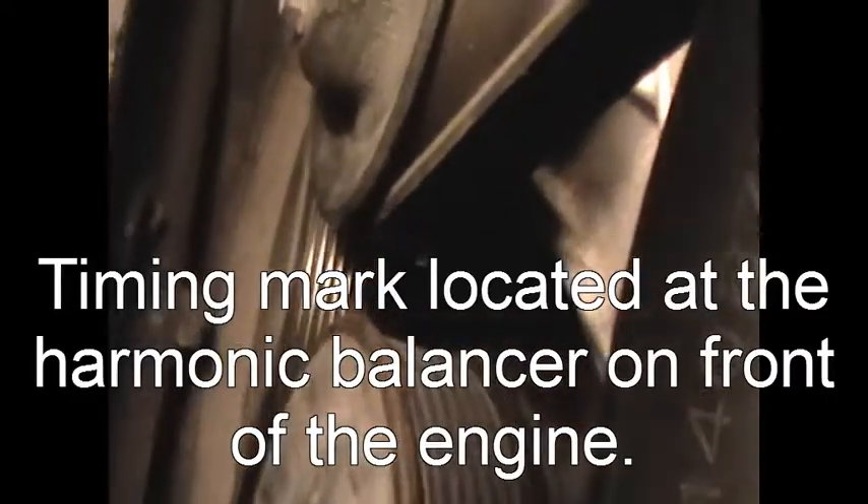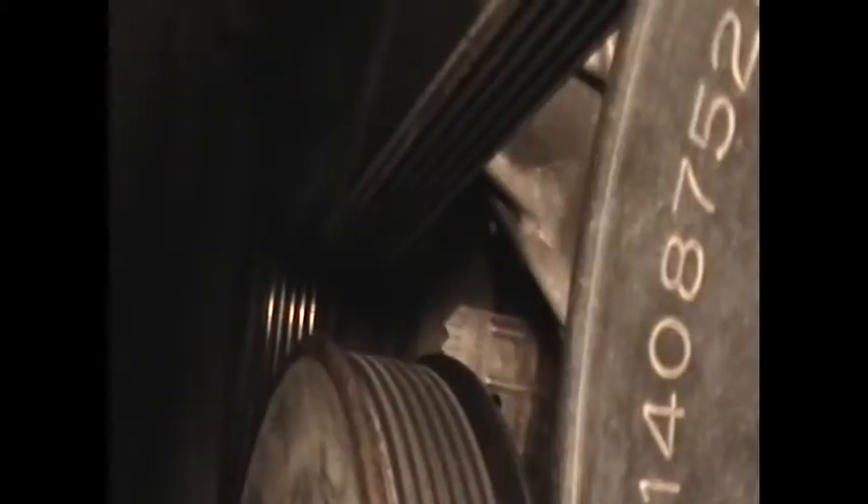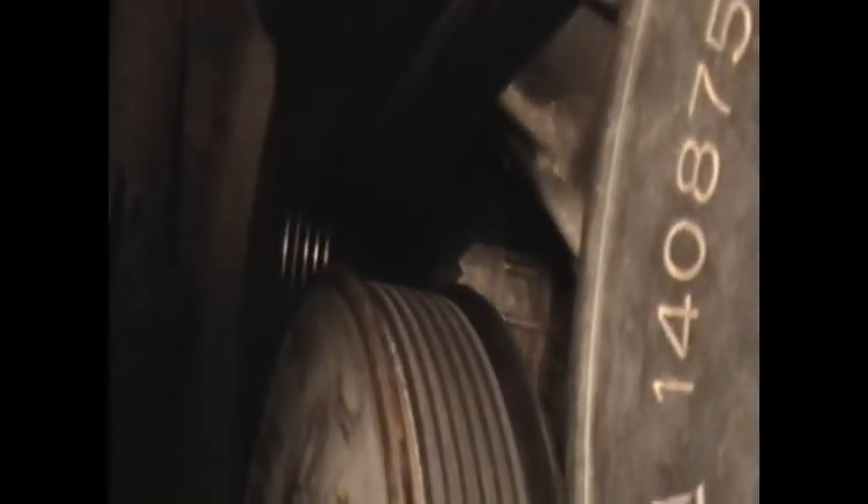When we check it with the timing light going, there's the gauge we're reading down there by the balancer. It's got numbers on it — see that little M-shaped gauge? Those are the numbers you read to get the correct timing. Turning the distributor cap back and forth is what adjusts the timing.